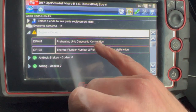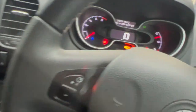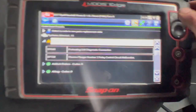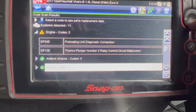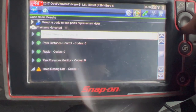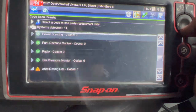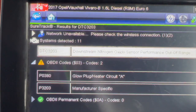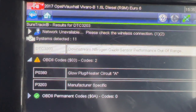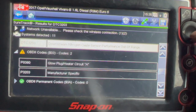Once I've cleared them out and you strike the ignition on, there'll be no fault codes in there — but the 'Check Anti-Pollution' comes straight back on the dash. If you scroll down, you're going to need a decent diagnostic machine for this, as there's a separate ECU with another fault: the urea dosing unit, which is for the AdBlue system. In there you can see fault DTC 3203, which relates to the downstream nitrogen oxide sensor — the NOx sensor.